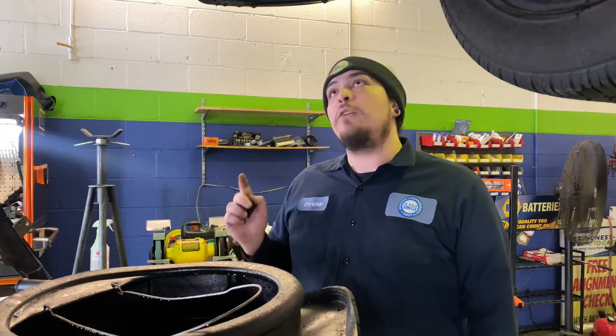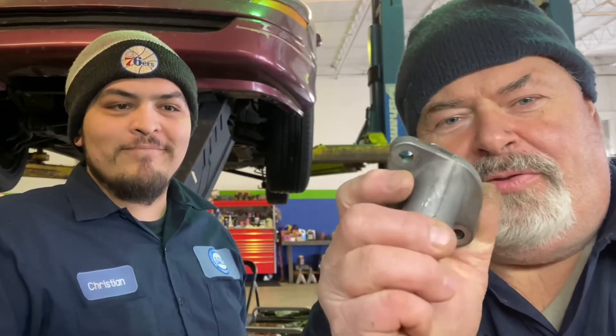Now I'm going to get that clamp off, take the lower radiator hose off, and get the thermostat housing and thermostat out of there. Chris has got the old thermostat out of the vehicle, and here is the new one with the new gasket. With thermostats, there's not always anything obvious by visually looking at it to tell you that it was defective — it's usually determined by all the tests we've done prior. After we get this new thermostat in we're going to do the same tests again to make sure it operates properly.